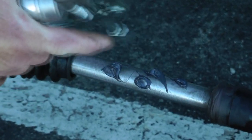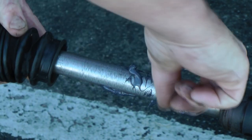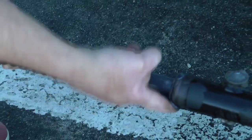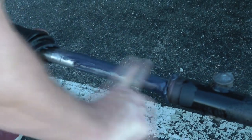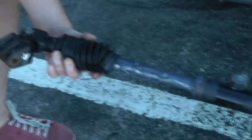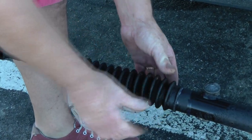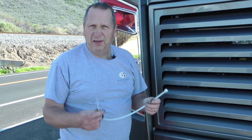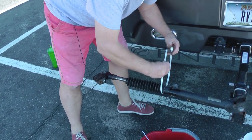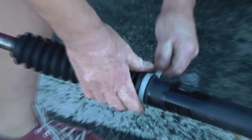I'm going to put a load of grease on the shaft now. Normally I'd use rubber gloves but I've run out, so unfortunately I'm going to get covered in grease. Liberal amounts of grease are required. To seal the ends you're going to need two sizes of zip ties - a large one for the large end and a smaller one for the smaller end. Grease up half the shaft with good quality grease and then use the cable ties.